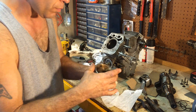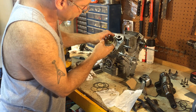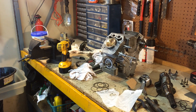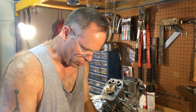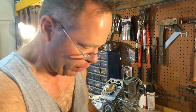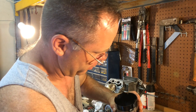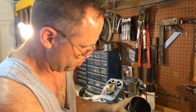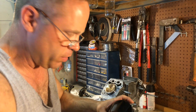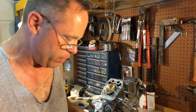We've got them all on there. The next thing we'll do is lower them down into the cylinders. But as you can see, the rings as they are now need to be compressed in order to get inside there. So we have this tool here — kind of a ring compressor kit. There's a little tool that almost looks like an Allen wrench with a square that goes inside. You rotate it and it closes, tightens up, and squeezes the rings in. You just lower it right down on here like that, tighten that up, then you can press the piston down into the cylinder.